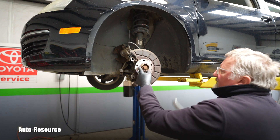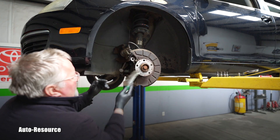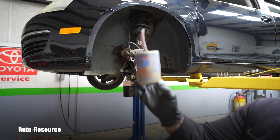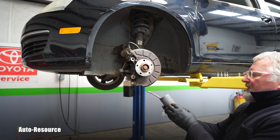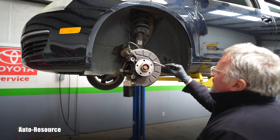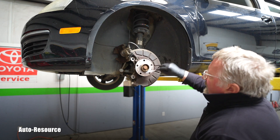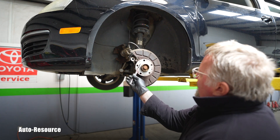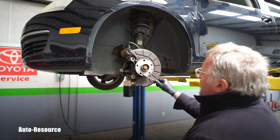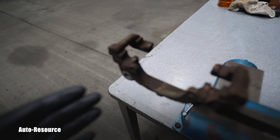We can see the hub and we can start with cleaning it. To get to this area I will use a wire brush, and to prevent rust I will use this — it's an anti-seize product based on aluminum. Apply a very thin layer on whatever surface you want to protect.